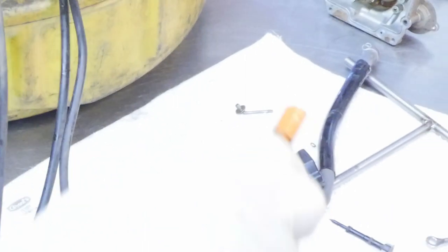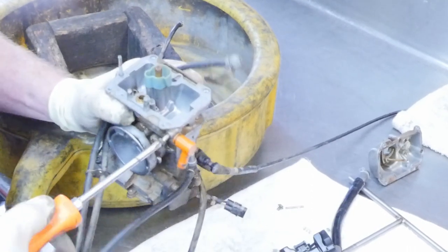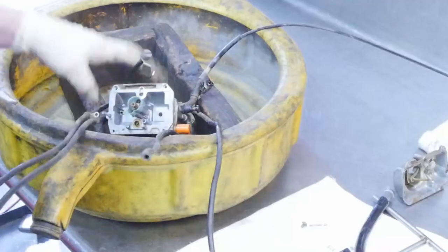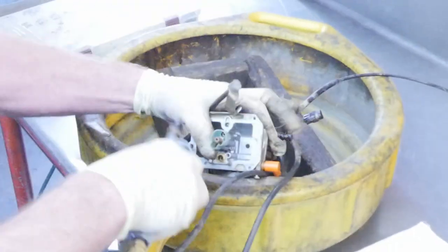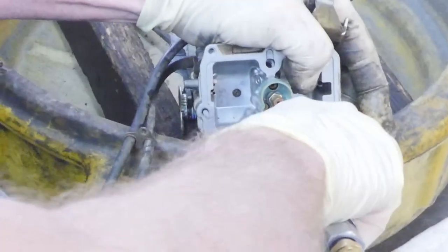For me, I made a little tool that's plugged — see how I just filled it with solder and plugged it, and it's got the O-ring. So I can stick this in here and block that hole. And I can use air to take that thing out normally. So let's give it a try and see if it works. It might not come out, might have to destroy it. Came right out — no problem.